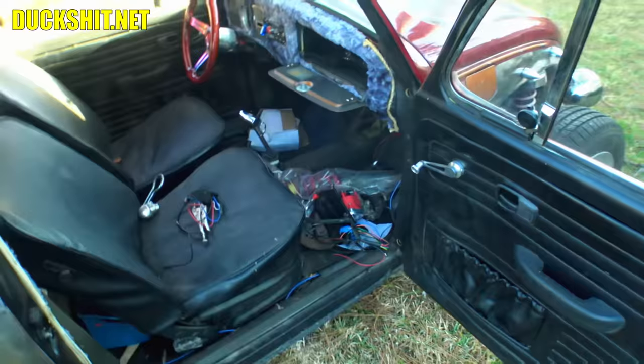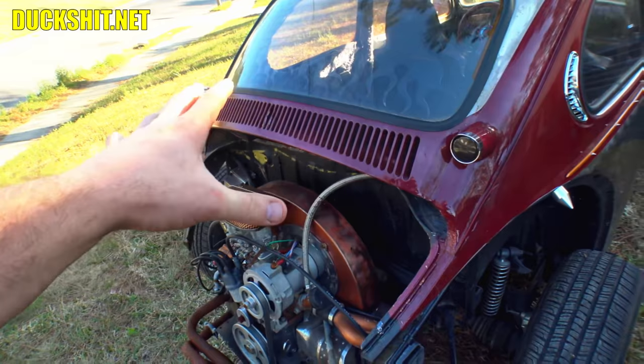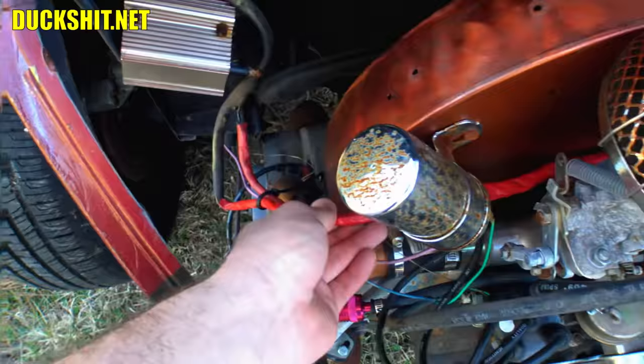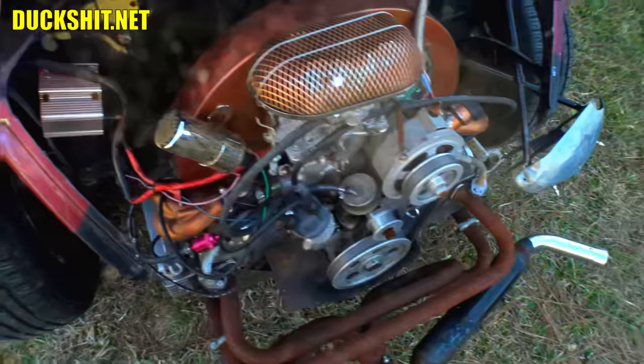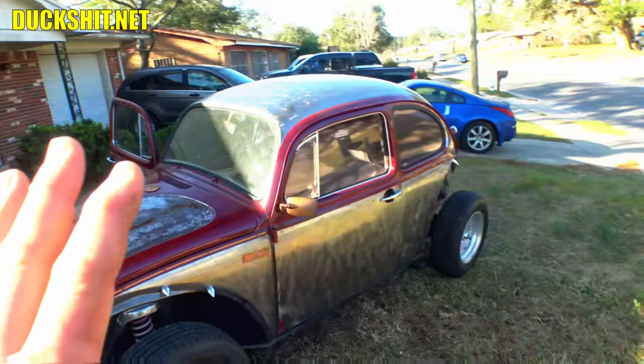Back around on the engine — we've got an alternator, but the regulator box was still installed, which doesn't make sense. There's another ignition box over here, probably related to the MSD — I'm going to suggest that's also cooked. The wires are wrapped and bundled, which suggests there may have even been an engine fire at some point. Looking at these wires, the colors are all wrong. Light bulbs are probably okay — they're pretty reverse-tolerant. Wiper motor would probably be okay, but there's currently not one installed. Headlights and turn signals are probably fine, and the switches in the whole car are probably fine. The regulator box down there doesn't belong in an alternator car.